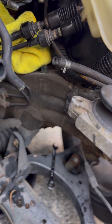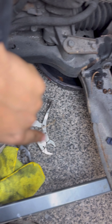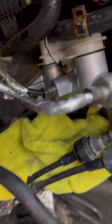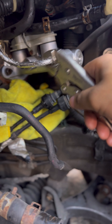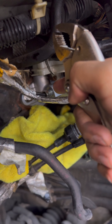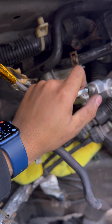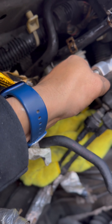Now the easy part — just pretty much reinstall. Slip it back into the hole, put the 10 mil back up here. This brake line right here, the one closer to you, is not gonna fit, so you're gonna have to figure out a way to bend it upwards to fit in here. Bending it wasn't really that hard. I took the vise grip, went around it without pinching anything, and used it to bend the line in the direction I wanted. Then I started threading that one on so the threads could hold everything together, and I manipulated it until it reached and I got it threaded on.